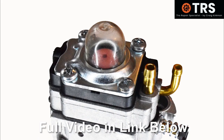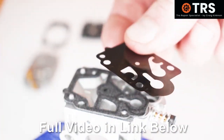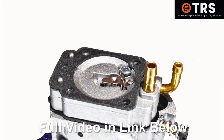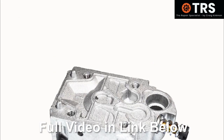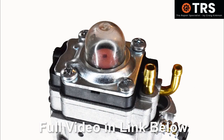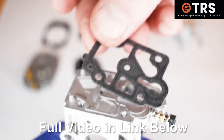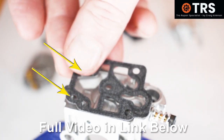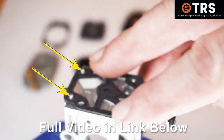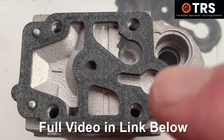But what if one might say, what if I take this apart and then put the gaskets and the diaphragms on the wrong way round? That's quite difficult to do as well. As long as you've got the sequence of what goes where, it's difficult to put the components on the wrong way round. And that's because if you take a look at the gasket as I'm putting it on, there are two holes at the end of the gasket and they go on to the two raised points onto the body of the carburetor. And when you look at the cutouts within the gasket, you can see they match that on the carburetor body.